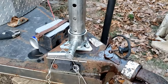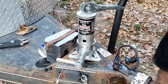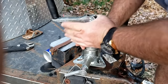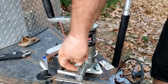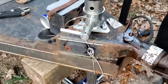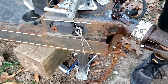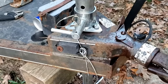We've got the foot on. Now I can pull the pin and slide the inner tube down to make the jack a lot longer, then lock it into place with the pin. Now we can crank it down — we're making contact with the ground and taking the weight off the support block. You can see it moving as the trailer weight transfers to the new jack. Now we can take the floor jack and block out from underneath.